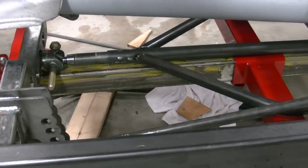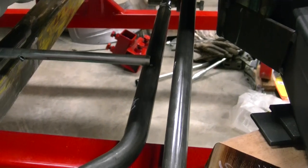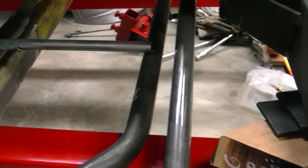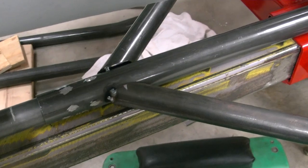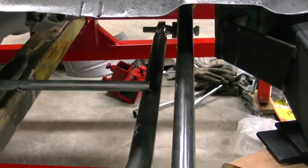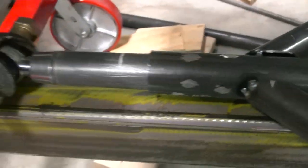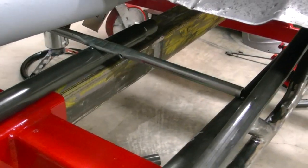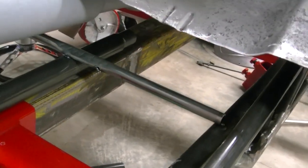We had to redo our wishbone because it was too wide — it was running right next to the ladder bars and in fact was touching them by an eighth of an inch, so that was no good. We ended up putting an inch worth of spacers back there — those are temporary — to space it out. Then we cut a little bit off of this end, which gives us our parallel, a little less than parallel, but very close next to the ladder bar. Our tube is just laying there and it'll raise up and center right there — it'll slide in and out. We still have a temporary brace, and we'll put diagonals running from the back to the middle to strengthen it up.